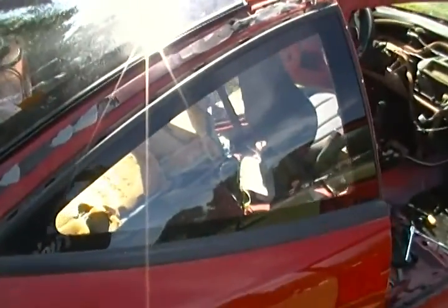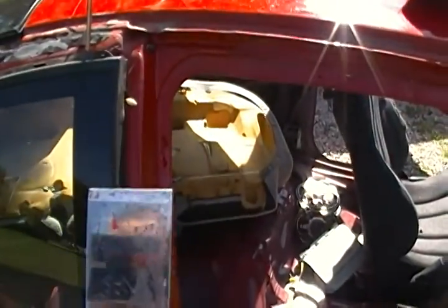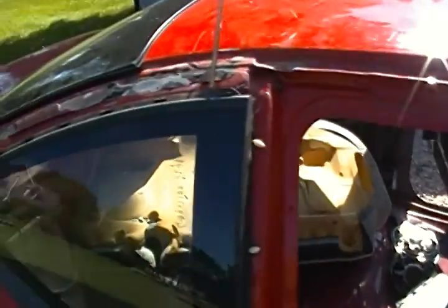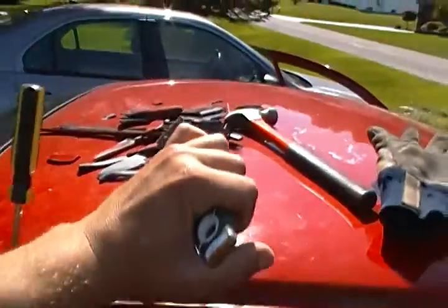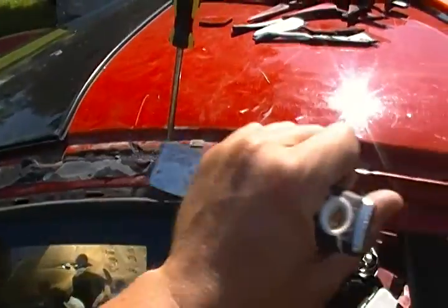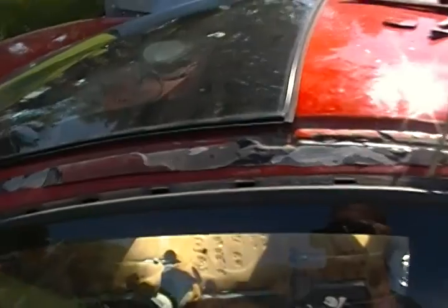The doors were very simple. The rest of the glass — the rear window, the front window, and these little side windows — are a little bit trickier. First I took the trusty flathead screwdriver and our little chisel and just kind of went in the side to break this loose. The plastic piece is now in pieces up there. I just chiseled my way down to break it off so I can fully expose this part as well as this part of the window.